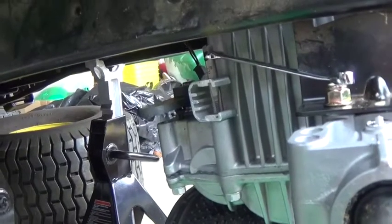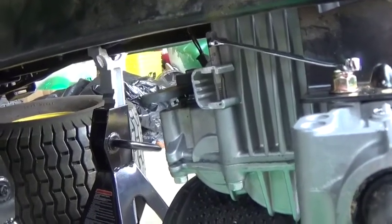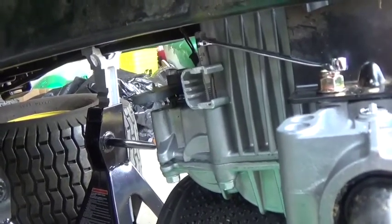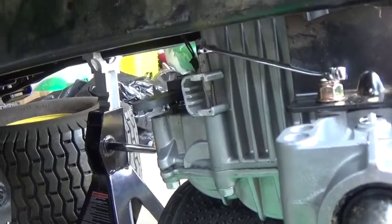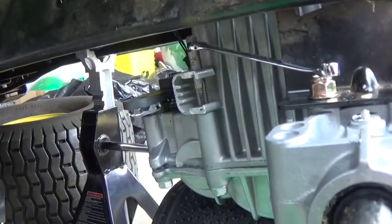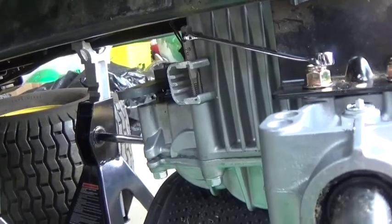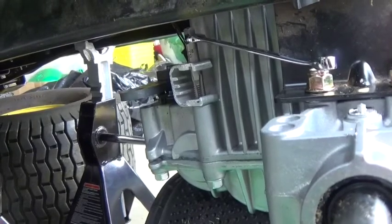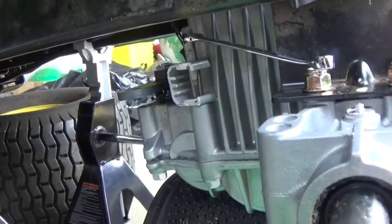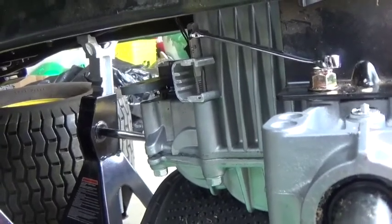So to give you some idea of what I'm talking about, that's what the wrench looks like on the tap and tapping block. You just got to really, at the very beginning, make sure that your tap looks like it's going in straight. You don't want to go in at an angle. And the hole isn't the same size as it should be for a 5/16 inch tap. It's actually slightly larger, so it should feel fairly easy to tap it. You don't want to force it, and when you get to the bottom, you'll know it. It'll suddenly get pretty stiff, and you won't be able to tap it any farther. So if you take your time, it looks like it's possible.